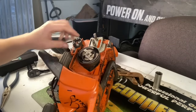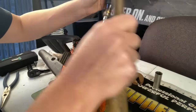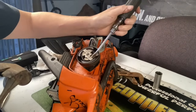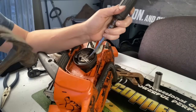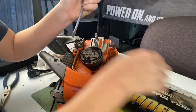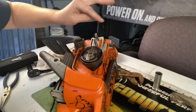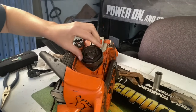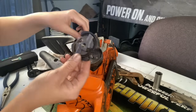Find the angle that's best for you to get your flat head standard screwdriver in. I'm going to go at it this way, put a little pressure on the chainsaw, and give it a little tap. That one came off much easier — I must have had this one off already. You will have to tap pretty hard and probably a couple times, but that is how you get your clutch off.